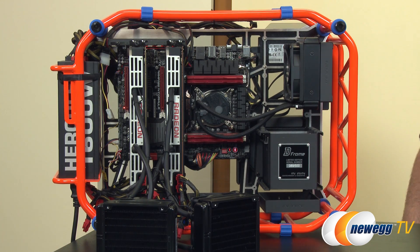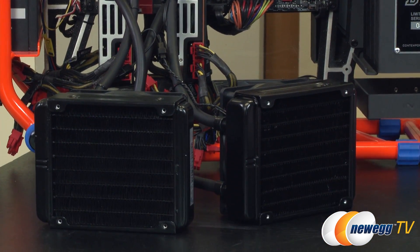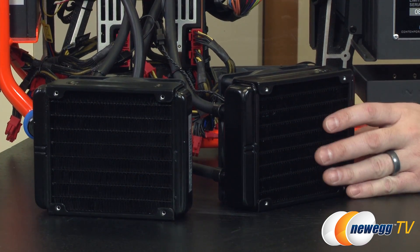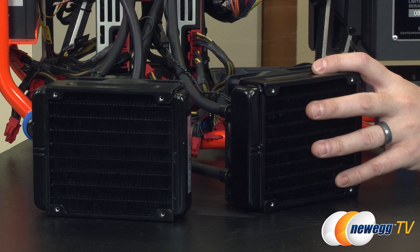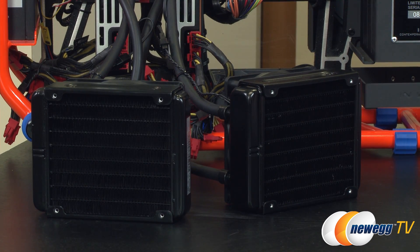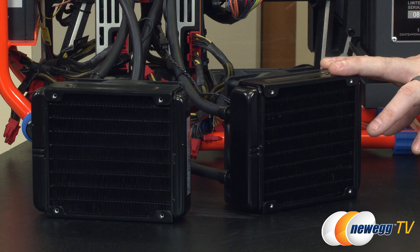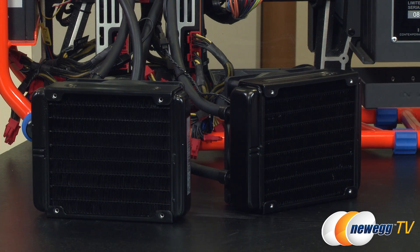A couple things to point out if you're actually considering going with a configuration like this. We have a couple of radiators since these cards are water cooled straight out of the box from AMD. These are 120mm radiators, a little bit thicker, and each one comes with a single fan. We're using a reference model straight from AMD as well as a version from Sapphire — we'll post a link in the description. If you have radiator configurations like this, when installing in a case you're going to need to find mounting points within range of the graphics cards themselves — you'll probably want a larger chassis with a fair amount of 120mm mounting points located adjacent to the GPUs.